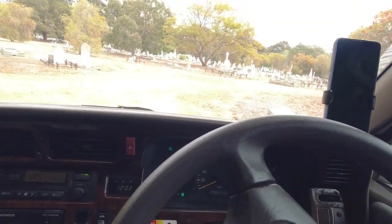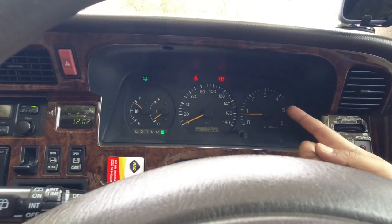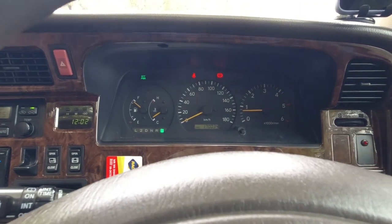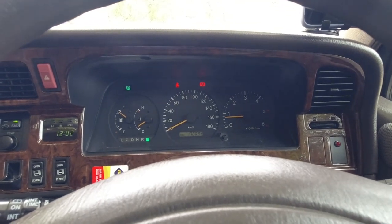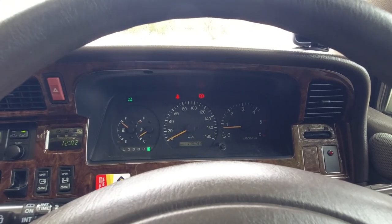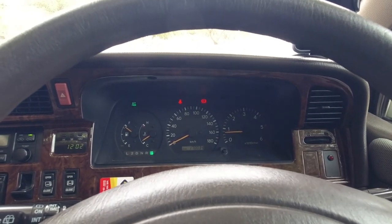Start the car up. Well, I should have mentioned already, if the car is cold, you want to check for the glow plug light, but really these use an afterglow system, which won't illuminate the light for more than 1 or 2 seconds, unless it's minus like 5 degrees Celsius. Toyota, I've seen on a label written in Japanese and I've had it translated, state that it's okay to crank the engine for up to 30 seconds.